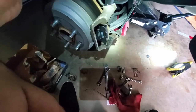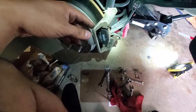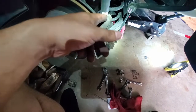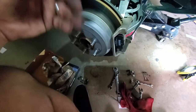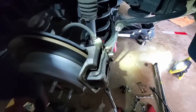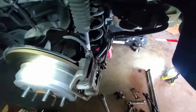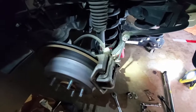This whole job, once you have your tools, will cost you maybe 20 to 40 bucks for the brake pads depending on the quality you go with, plus a few bucks for any replacement bolts at your local auto parts store — far less expensive than the shop. When putting everything back together, make sure you torque it properly. Some slide pins have a holding spot where you need to put a wrench on so they don't spin when you tighten the bolts. Make sure you check your manual.